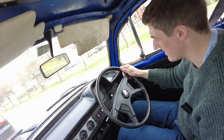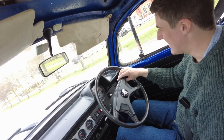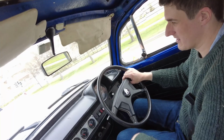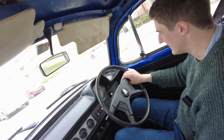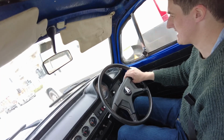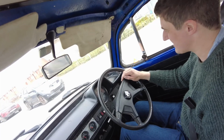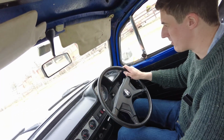Yeah, the oil pressure light is on. Engine might be getting a little bit hot and bothered. There is oil pressure, I have a gauge here, but sometimes in a Beetle engine, when the oil pressure light is flickering on idle, it's simply because the engine's getting a bit hot and bothered. But also it's because it's idling slow because of that blocked idle jet, so maybe it's just that. Anyway, look, I'm not overly concerned.